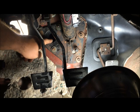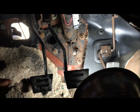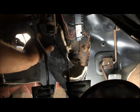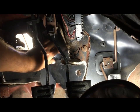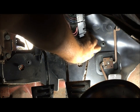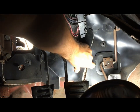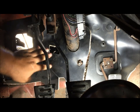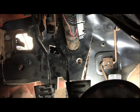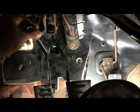Now we can see the hole — I forgot to deburr that, I'm going to deburr it. Now we go ahead and put the clutch rod through it. Let's test fit this first — it's got a square cutout for your rod. I'm just showing you: the hole is there like this, with a zigzag right at the firewall.